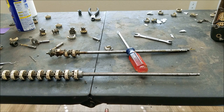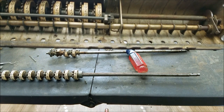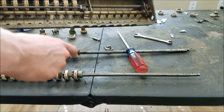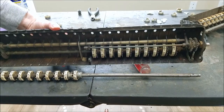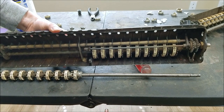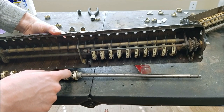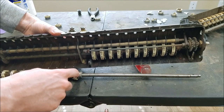I think there's a specific place where this goes — I think it might ride in this thing here. This is the carriage from the parts machine so you can see it's a bit smaller. In the carriage for the good machine I think it has one of these, and this round thing — you can see how it's a bit worn there — I think that's going to ride in here. So it is position dependent. You can see when this goes in like this, this cutout here lines up with the worn spot on the round one. Make sure you get that in that position — I'm not sure if it would matter if it's wrong, but just know that this lines up with this thing here.